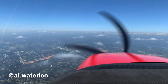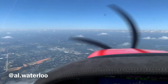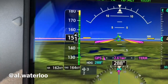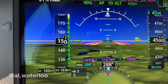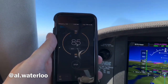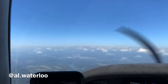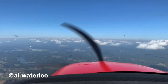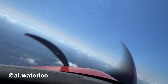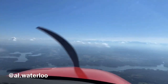Now leveled out and leaned for cruise at 4,500 feet, the true airspeed is very typical of what we'd see with a three-blade propeller — so performance-wise, not too off-base. I'm also doing a noise check with a decibel readout on my phone. Leveling off, I'm seeing somewhere around 83 to 85 decibels, which is basically what you'd get with a three-blade composite prop on the SR22 Turbo. So the sound profile is relatively the same. I do feel a slightly different vibration profile.